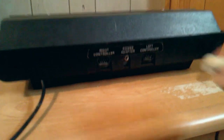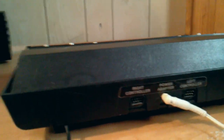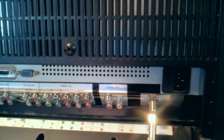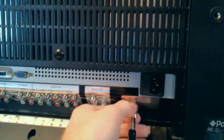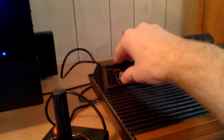Setting it up is pretty easy. First you want to plug in the power adapter. Then you want to take the RCA cable with the little adapter on it to the back of your TV — you should see a cable/antenna plug-in — and just twist it on in there. On the TV side of things, you're going to want to set your input to TV or cable, then switch it to channel 3 or 4. Your Atari might be set to channel 4. Then just turn it on and see if it works.